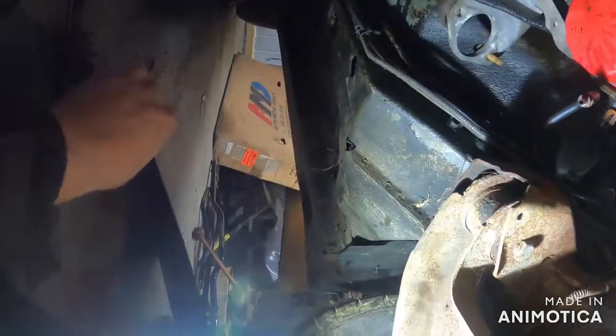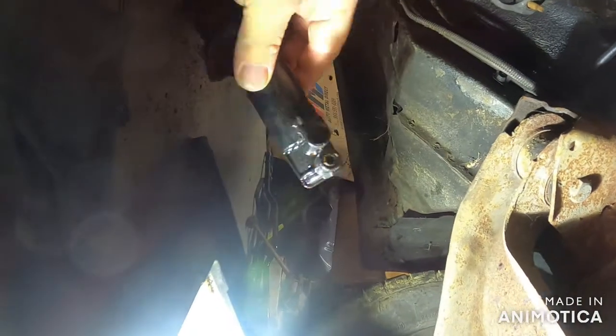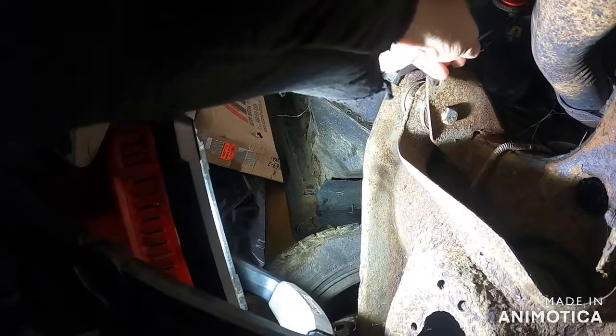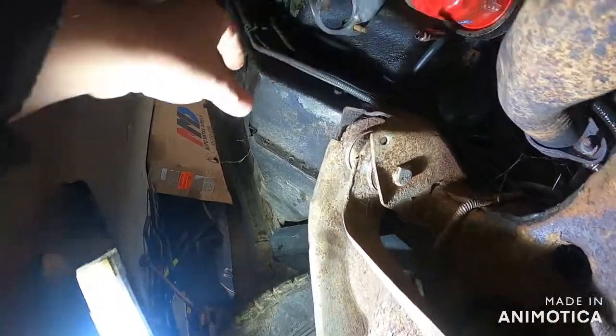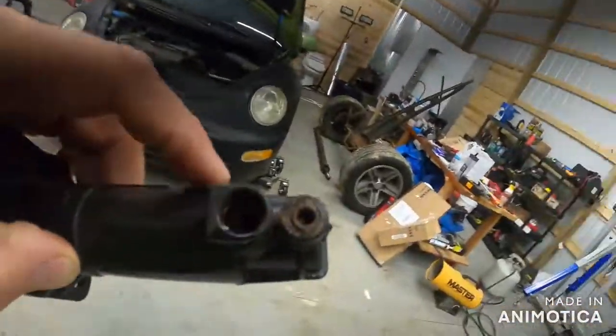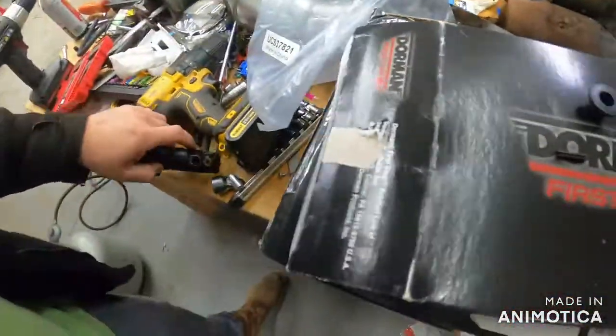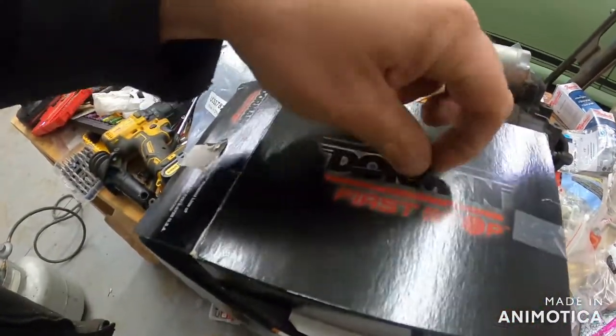Is that really it? I kind of feel like I cheated the system or something. There's supposed to be an O-ring seal somewhere — it may have retired, I'm not really sure. So we're going to pull this old one out of here. I don't see an O-ring in there. I'm 100% sure there was one. But I do know the kit came with one. This right here is just a plug you can remove, this right here is an O-ring, and it comes with your brand new dowel pin to put it back together.